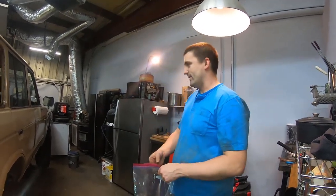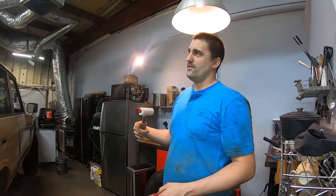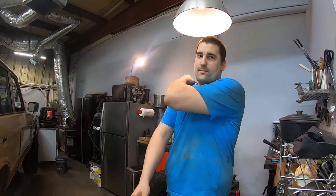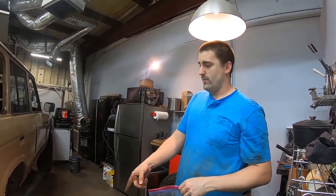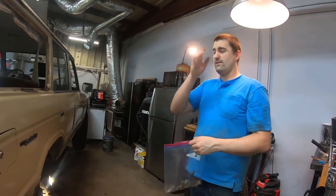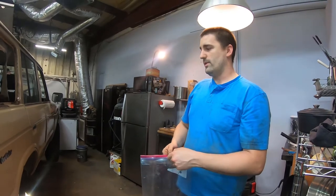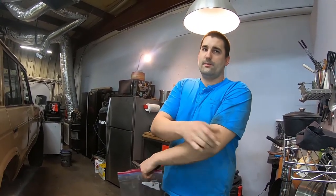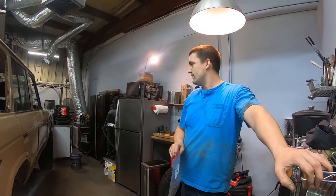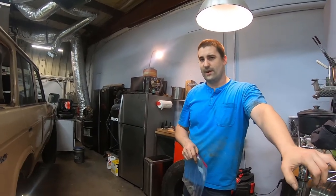Really? Because I test drove it again today, and you could hear something in the front. It sounds like maybe a caliper seized or something. You said when we were bleeding them, there were some noises coming from the back, right? Yeah, that was the emergency brake, since it was seized. You could hear the cable pulling when you applied the brakes. I thought the front calipers were brand new. They are, but maybe one of them is a defective part, or it's just seizing a little bit. So maybe you need to break it free. I don't know. They are remanufactured, so who knows?